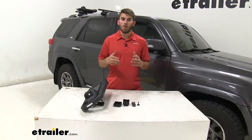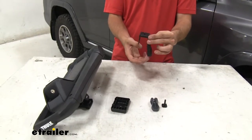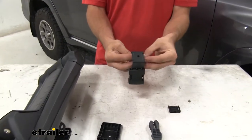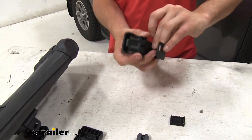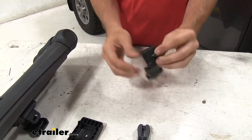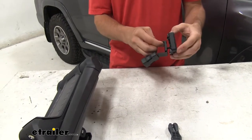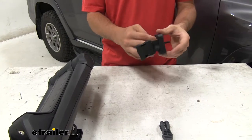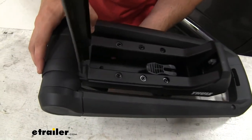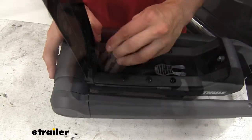Now let's show how to set up the square bar adapter kit if you have a square bar setup. Grab the bracket piece with the little folding piece, pop the cap off that side, take your T-bolt, slide it up and through. Flip it back over — you can see the T-bolt right there — put the cap right back on and make sure it snaps on both sides. Then grab the cap, slide it up and in straight through; if it gets stuck, you're putting it the wrong way. Grab your carrier, get the bolt up and through, take the clamp and thread it on. Now you can get it on your roof.